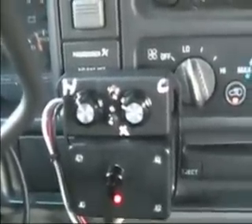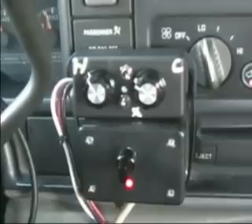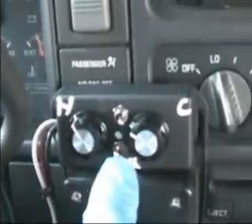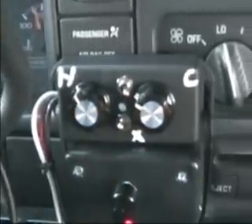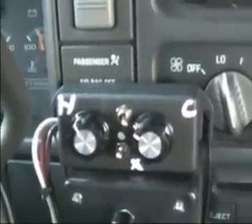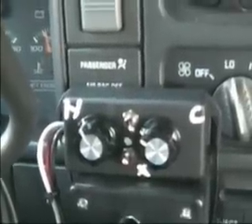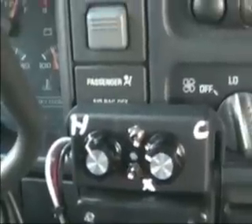We're inside the vehicle now and we're going to attempt to adjust the map enhancer. We have the vehicle at engine idle — as you can see on the tachometer, it's at engine idle. We're going to make sure the switch is in the on position. This is the off position where the X is; this is the on position. When hooking up the map enhancer, make sure the battery is disconnected when you make the actual hookup, and make sure the enhancer itself is turned all the way off — knobs all the way counterclockwise and the switch off — until you're ready to make the adjustment.